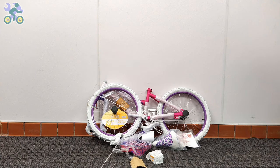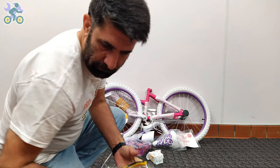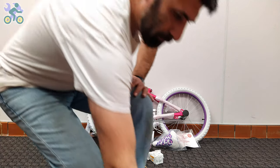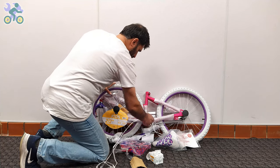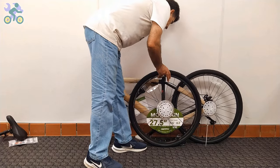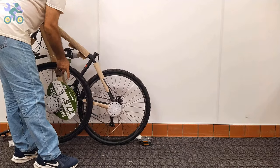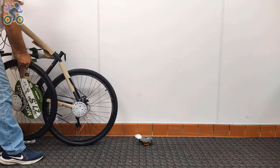After removing the bike from the box, check the inside of the box completely and do not throw it away until you finish assembling the bike — many times a small screw or nut was still hidden inside, even under the flaps. For ease of assembly, remove all paper and plastic covers from the bike. Be careful not to damage the paint when removing them, as this may lead to rust over time. Also be sure to remove any remaining tape from the body, as it will affect the bike's paint over time. For bikes 24 inch and up, removing a bike tire can be challenging — be careful not to apply too much pressure as it can lead to bent or broken spokes.